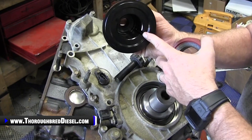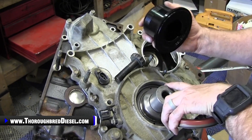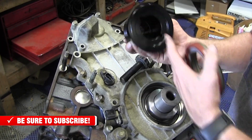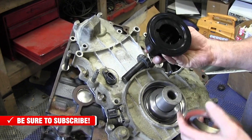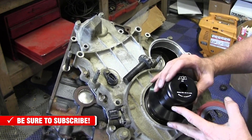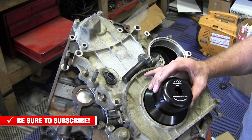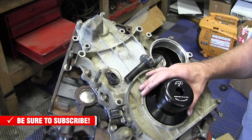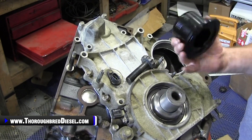It's recessed to go over the roll pins, or if you key your crank it will go over the key in the crank. If you double key your crank for whatever reason, it's going to accept that as well. It lines up and sets the depth just perfectly because it rides against the end of the crank, which puts the seal depth almost perfect.